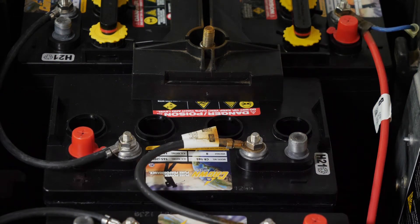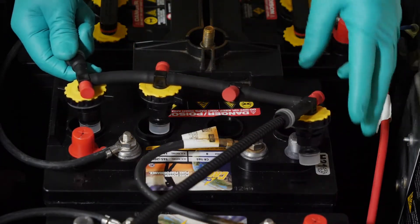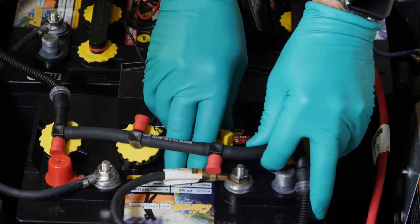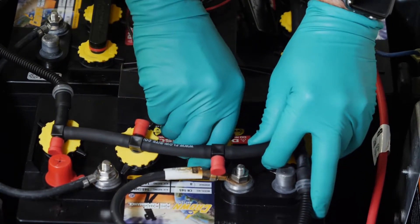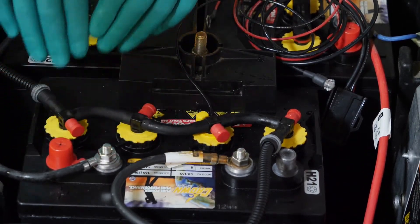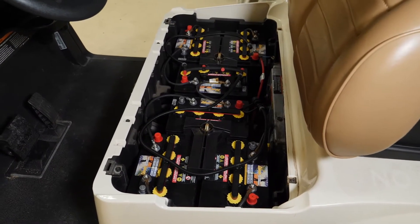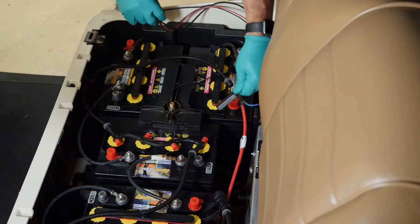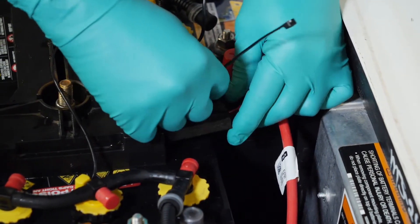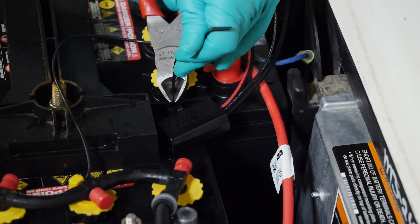To begin, locate your main battery positive and negative posts. Next, place the sensor valve on the pre-assembled flex manifold and install them into the battery. Use care when installing the probe. Make sure to lock each valve in place on the battery and reconnect all tubing. Now secure the control box with the provided zip tie in a secure location. Do not secure the control box to the watering system tubing.